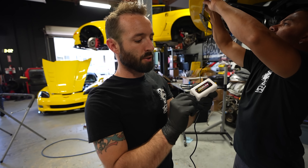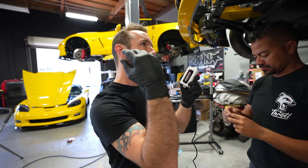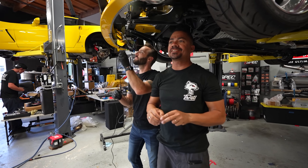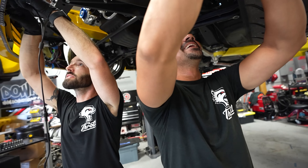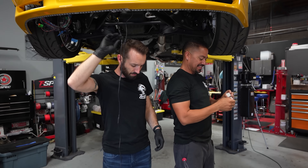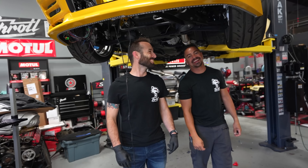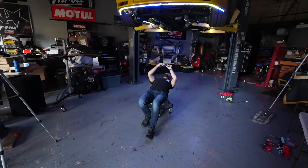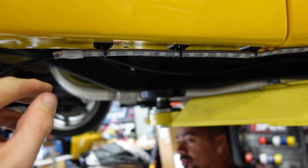That's better, you did a good job — pretty quick. Now I gotta put the little screws back in. Hub time! So this is the brain controller — it's getting a constant 12 volts from the battery right here. This is a three-wire data and power that goes to your actual lights and controls the multiple colors and the strobe rate. That was a way better explanation. It gives power to the light bars.